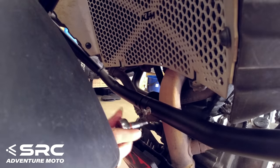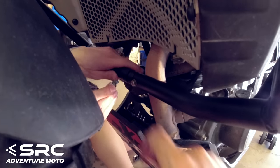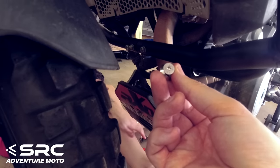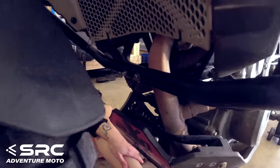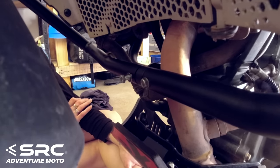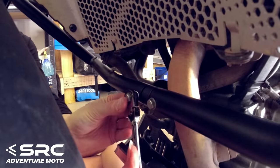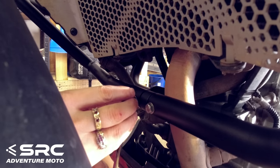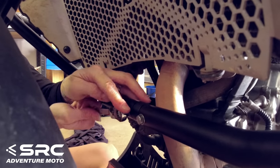Is it that tight? So, guys, we've resorted to using some different bolts for these. They're just bolts with 10mm hex heads on them rather than these little 4mm Allen key things. They just flog out too easily, especially when the metal that we're threading into is powder-coated. It's quite tight for the bolts to get in, and the heads just flog out on them. These 10mm hex head bolts are going to be a lot easier to get in and out. So yeah, just a little tip from me. I reckon switch out those stupid little Allen key bolts. I mean, they look a lot prettier, but these are a lot more practical. You could probably run a tap or something through those threads before you put the bolts in, but meh.